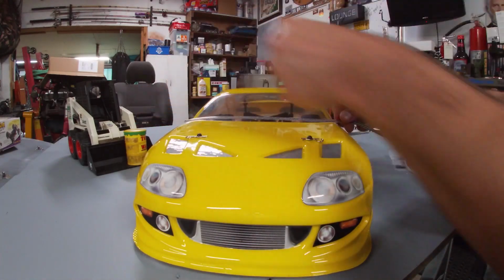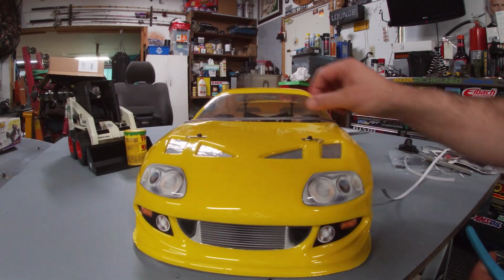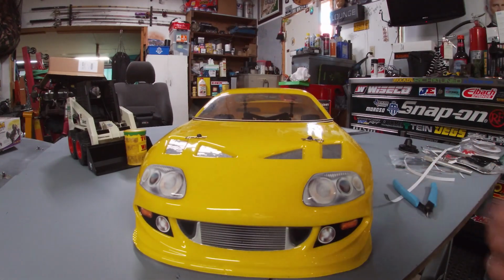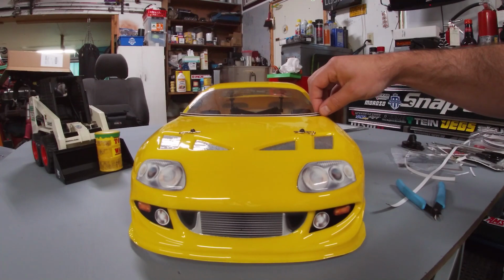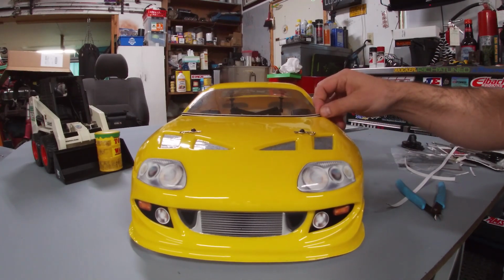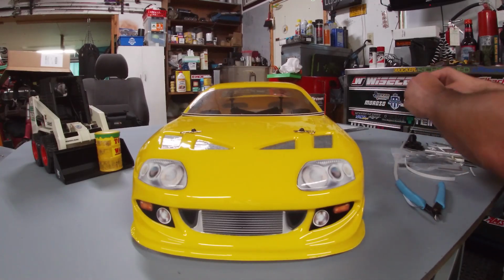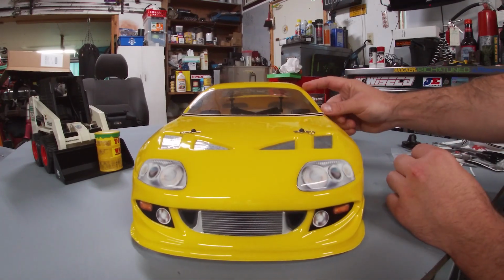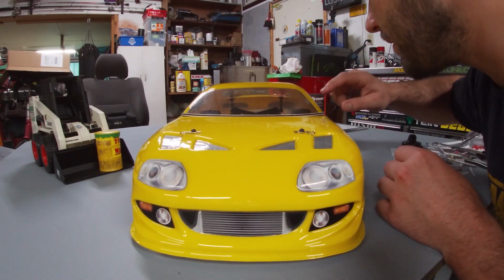So we need to do one across the bottom. Just cut it a little long because it's gonna bend too. See? Okay, sorry about that. So, like I said, cut a little extra because the radius is gonna take up some travel. But look, that's gonna be perfect. And then this one, we could probably get one whole piece. Sometimes it's just easier to do it in sections too. Like I had a rip right on one of these and I ended up replacing this section on the pillar. And if you have one little flat seam, it's not that big of a deal.